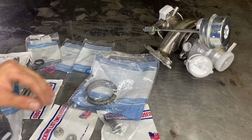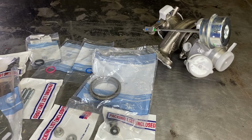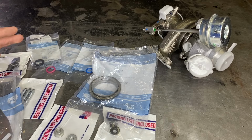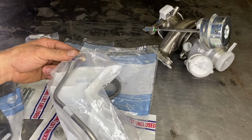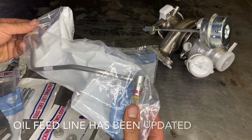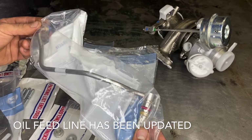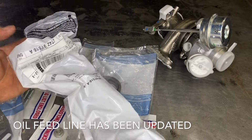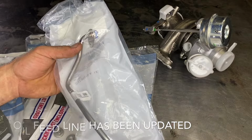Now, when we're replacing the turbocharger, there's a whole bunch of gaskets, O-rings, nuts, and studs that we're gonna have to replace with it. I'll go ahead and throw a link in the description for the parts and the tools that I used during this video. We're also gonna have to replace the oil feed line that goes to the turbocharger. There's a non-serviceable filter at the end of this line that just filters out any debris going to the turbo. You can't buy just the filter, you have to buy the whole entire line. So I'll make sure to include this in the link in the description. It's a pretty important part as well.